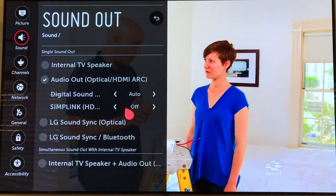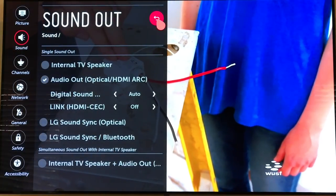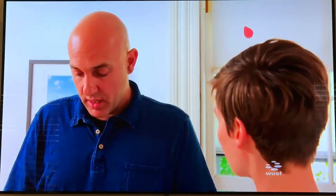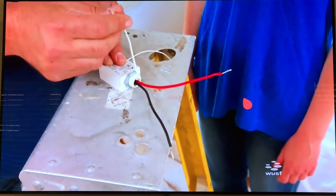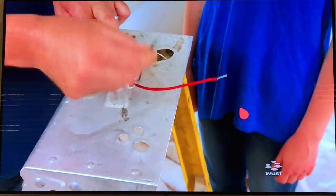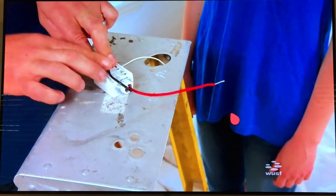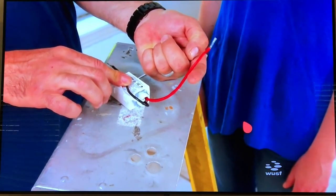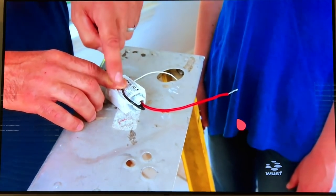Your sound is essentially off on your television. You're not using CEC or ARC, and you're not connecting any optical audio from your TV to your soundbar. Your TV is just a monitor, and all that rich, uncompressed sound is going right to your sound system. Your sound system will then handle input switching for different sources, and a universal remote solves that problem.